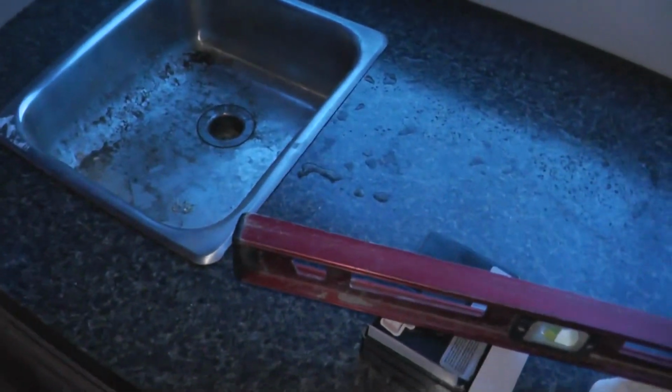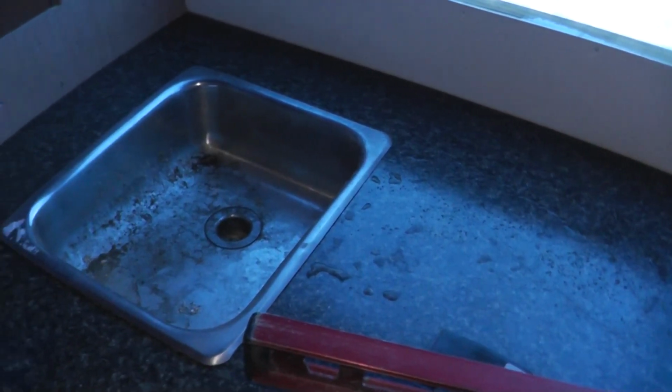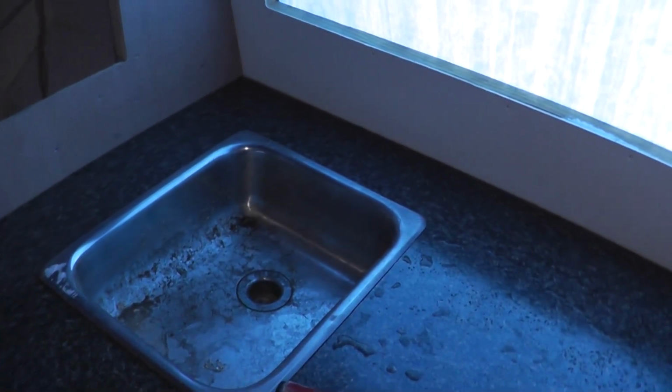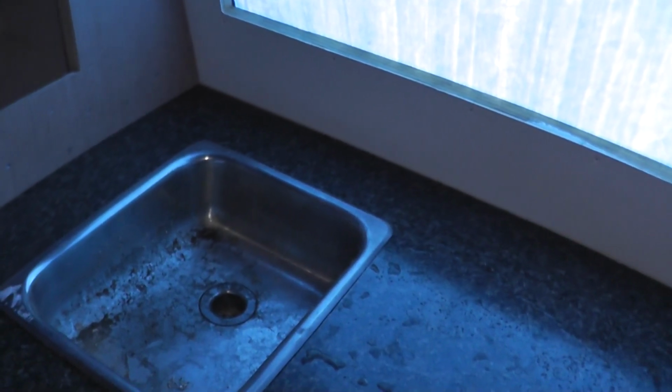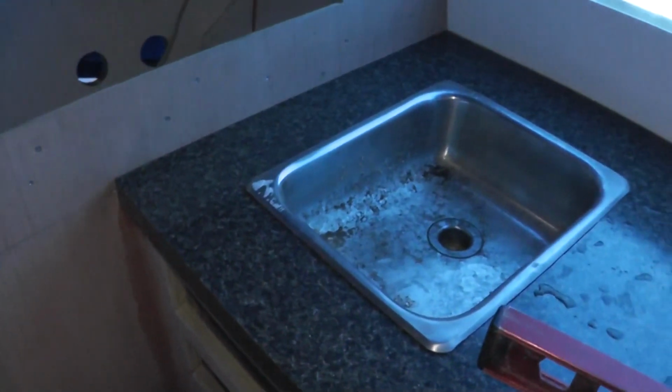This is just more stress and more motivation as well to get this thing sealed up. I ordered 5 rolls of butyl tape for sealing up the windows, and I'm still trying to get some screws that are similar to the original hex head screws to secure the windows. After I put in the windows, the door, and corner trim or drip rail, whatever I decide on, then it should be watertight, but this is just a real bummer. I really don't like seeing my brand new work damaged by lack of waterproofing, originally, because the trailer was rotten, ruined by water.